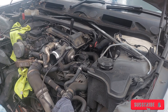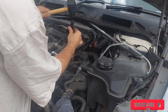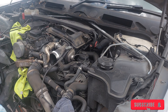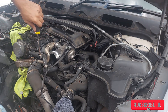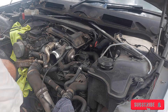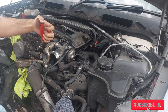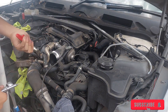After removing a couple of hoses — and here's me being an idiot trying to shove the screwdriver in not realizing there are two bolts underneath — if you're just doing the EGR delete you probably won't have as much clearance as me. The next piece is a little hose that you unscrew with a flat head and then remove. One of the caps from the kit is going to go inside there, and it may be tough to pull out so I've got a tool for that.